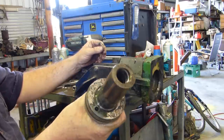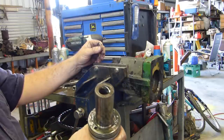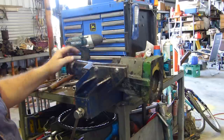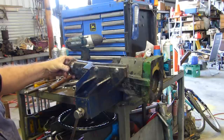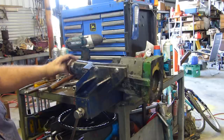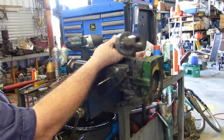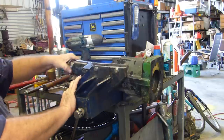This has a thread inside it and your steering column engages in that thread. As I turned it up here before, I could make it go in or out - that's the manual steering. There's always a little bit of movement here and that works the valve. So when you turn it clockwise to the right, that moves this but it also opens the valve and gives you hydraulic assistance pressure as well. We'll put this aside and see if we can work further around.